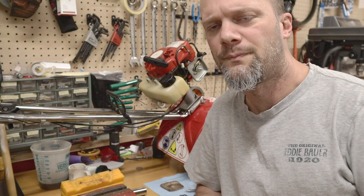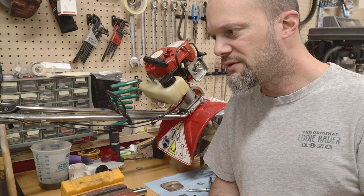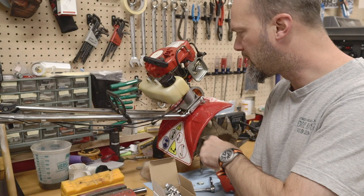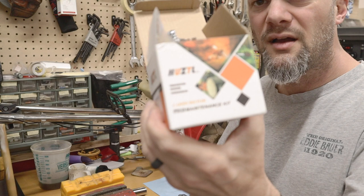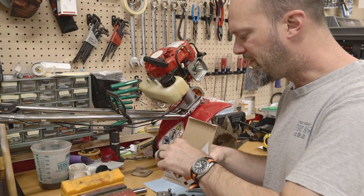Since I shot the video on the Mantis cultivator, I've cleaned it up — it's fairly clean, pretty shiny actually. I pulled the carburetor off, looked through it, and it's probably rebuildable. But I went on Amazon and found basically a full rebuild kit for about 20 bucks with really good reviews — made by some Chinese manufacturer. I need a carburetor kit, an air filter since it's completely soaked in oil and dirt, and fuel lines since they were all crispy and baked.